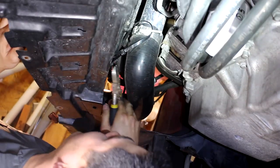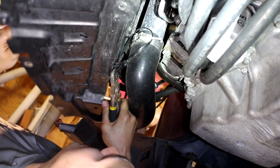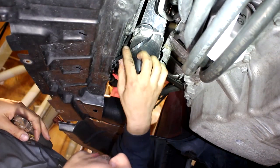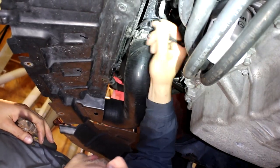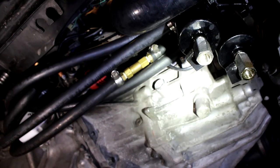I got a zip tie here, so nothing rubs. It helped. But we are getting rid of this now and going with the under route piping because why not, man? Look at all those PCV lines. Yep, that's for the dual catch can setup from Damon Motorsports. Both of those cans are vented though, because I want as much crankcase pressure relief as possible. Ever since I had issues with the BNR S4 turbo smoking, I had to do everything I could.